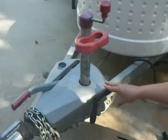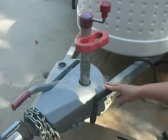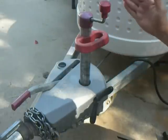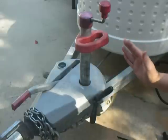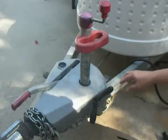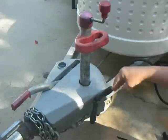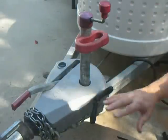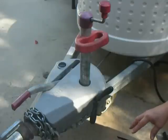Also, as some other people on the Facebook group have said, it's important to be sure that your post is coming straight up. If it's coming out on an angle when it's under load or not, then it's possible the wedge has slipped out of its position. You'll want to wiggle it to be sure that wedge is down in there, because if you don't, the thing can release and let the front of the trailer fall down.